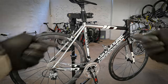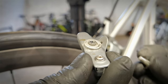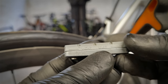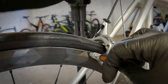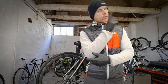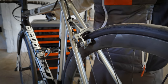Fixing this life-threatening mistake is very easy. You simply want the R braking pad on the right drive side and the L braking pad on the left non-drive side, and the arrow should indicate the direction the wheel spins forward. On the road bike, it's quite similar. This is the braking pad of the old Tiagra brakes from 2014. You can see the spacer on the braking pad side, the small spacer with the bolt on the outer side, plus the wear limit line and the retaining bolt.